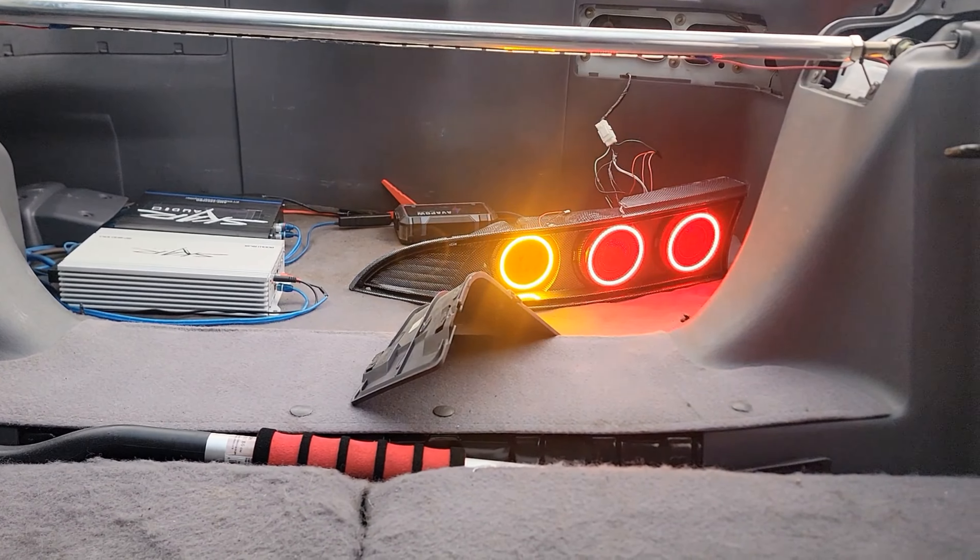On this plug there is a solid green wire — I believe there's two of them. You're just going to cut the one that's closest to the center clip, it's like the second or third pin. Behind the driver's side rear speaker panel area, there are wires with a plug. You need to tap into this solid green wire — this is a solid brake signal for the third brake light on the rear windshield high mount.